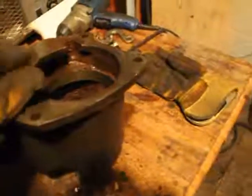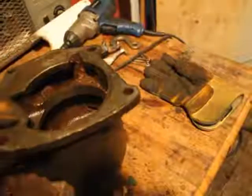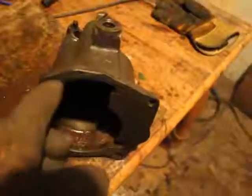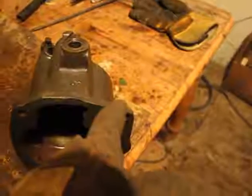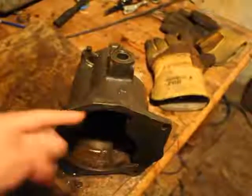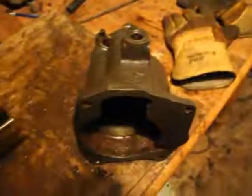All right. I mean, if you have to, you can put a chisel on it. The beginning is really hard. The first part is really hard, because you're not able to put the pry bar in. So you can put a chisel, but just go easy on it, because chisels break easily. But actually, you can see where I used the chisel there, right on the edge there. It's a little bit of a chamfer now. It just chamfered it that way. Didn't chamfer it this way. It damaged the gasket a little bit. That's not a problem. That's normal, okay? That's normal procedure.